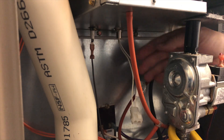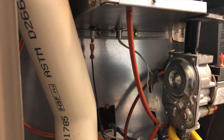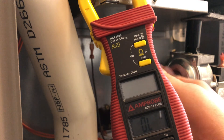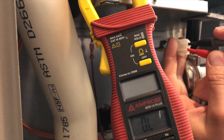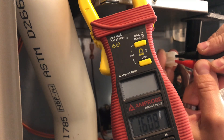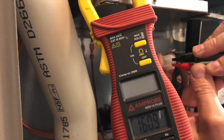I've got the power wire disconnected — it's normally plugged into this connection right there. I've set my meter to ohms. Ohms are a measurement of resistance and we're about to test the resistance on this igniter. I'm going to put my two probes one on each side of this igniter and ohm it out. It says we're at about 160 ohms, which is really high. Generally anything over 100 ohms I would recommend to a customer to replace their igniter.